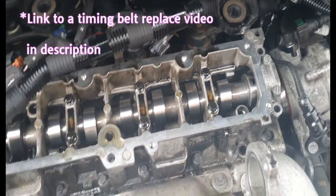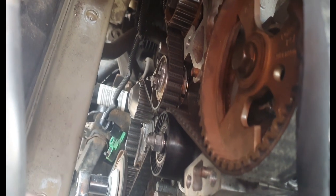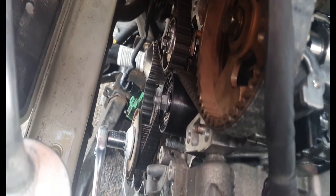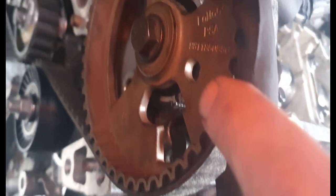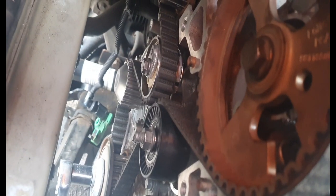Sorry about this video - it's been a bit rough, I'm just trying to get this sorted. The new timing belt is on, tensioned, and everything's timed. There's a hole here where you can lock the camshaft, and down the bottom there's a hole on the crank you can just see at the tip of my finger - those line up and you lock them. I've done all that, spun it round hundreds of times, and everything feels good - fingers crossed.